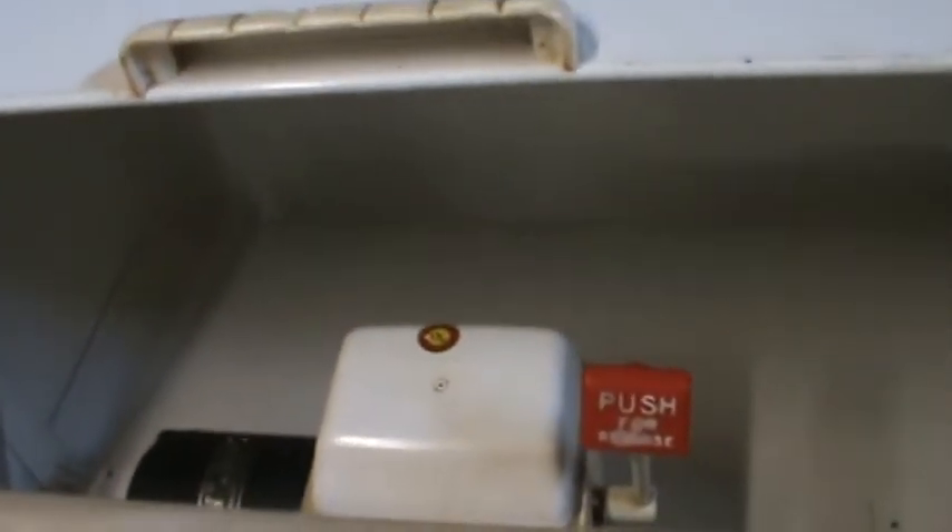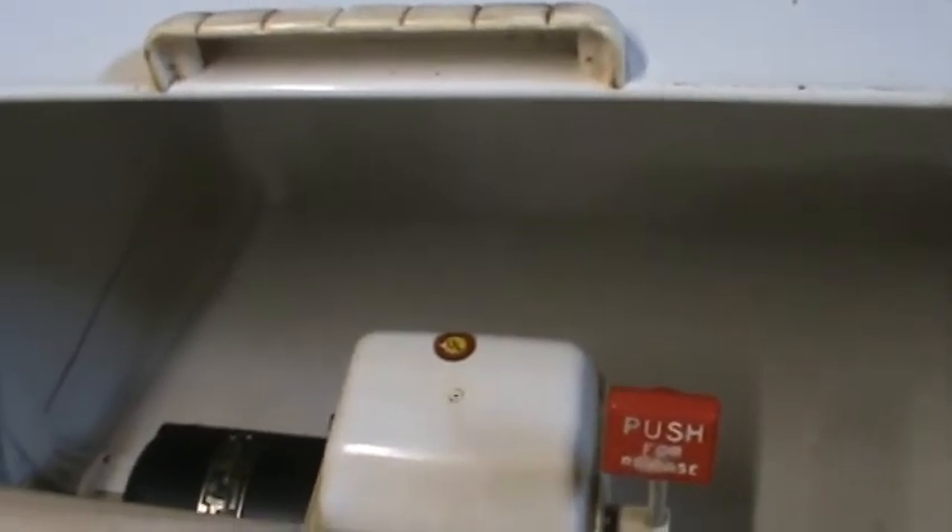After removing the original cord, I wrapped a couple of zip ties around the cord as a simple strain relief, made sure they were nice and tight, and put another one on the back so it couldn't be fed back through. You just run the cord through the one hole and then through the hole right below the junction box. I had taken the plate off — be careful as it gets a little oily inside. That made it easier to fish the cord through. I also used a couple of zip ties under the terminal strip to make sure it can't move back and forth. The original cord just had a little spring-loaded washer to do the same thing.